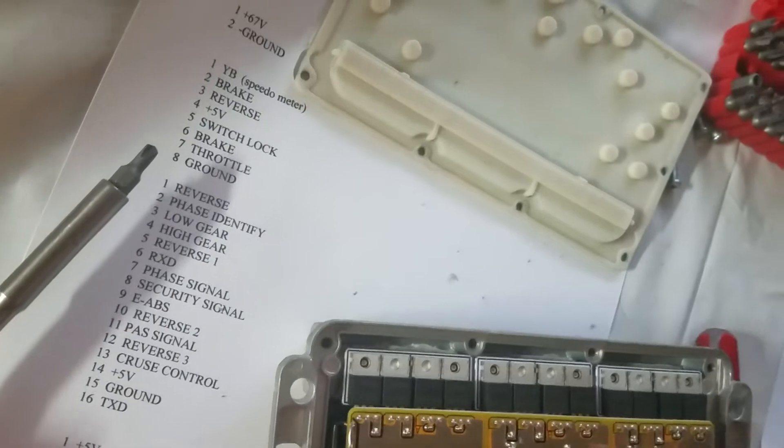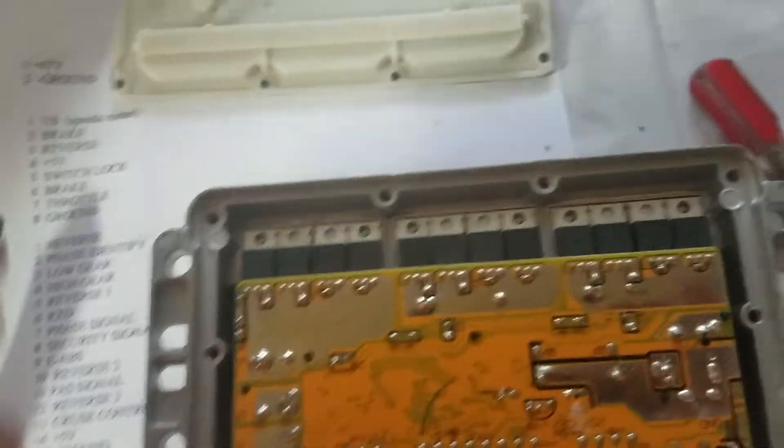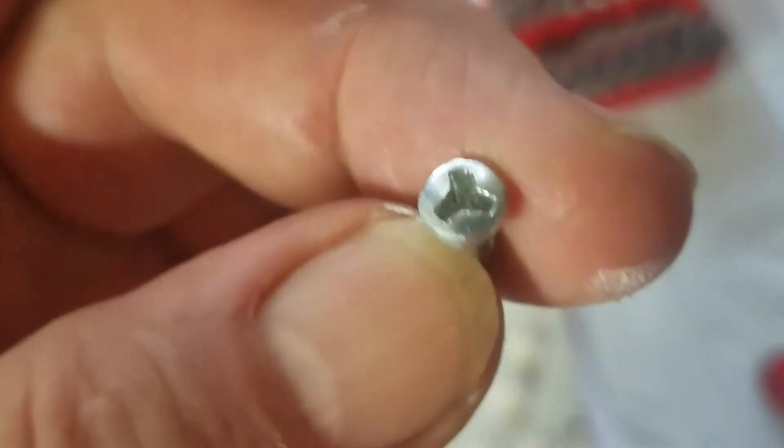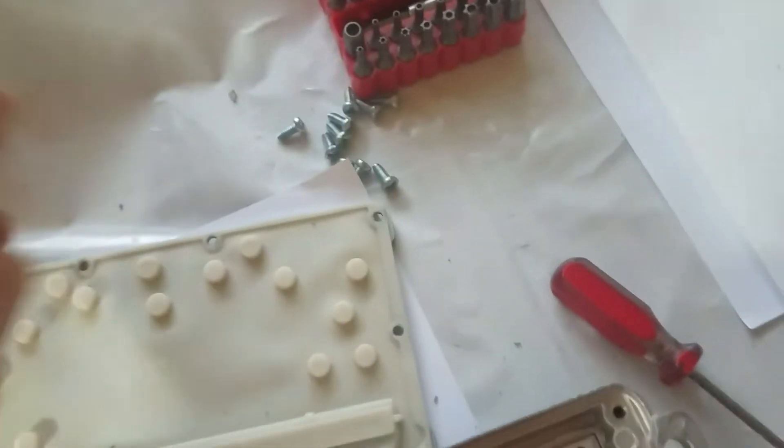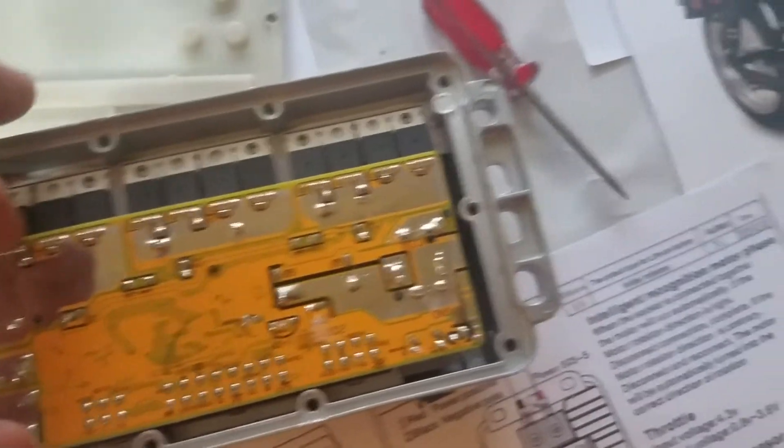This white cream here — make sure you re-spread it out evenly. That's for heat transfer; don't wipe that off, it's very important. Then put it back together and make sure you tighten the screws very tight. You can replace them with regular screws if you want, but to get the originals out you need the specific security bit — nothing else will work.